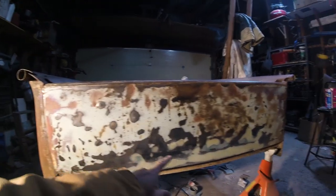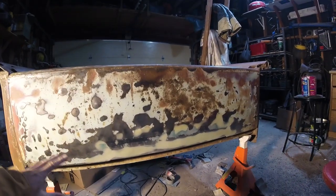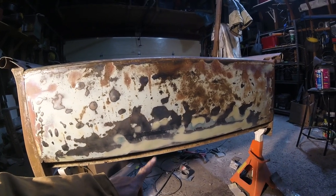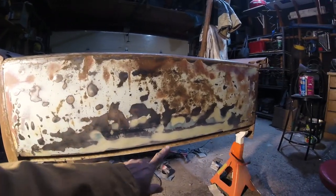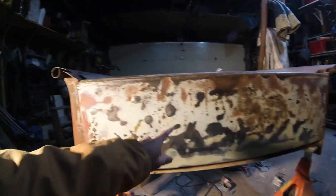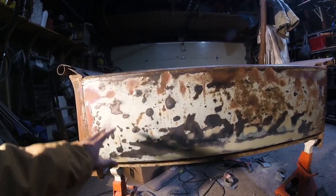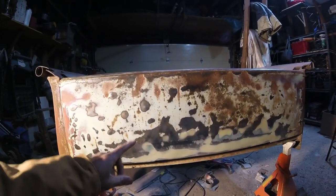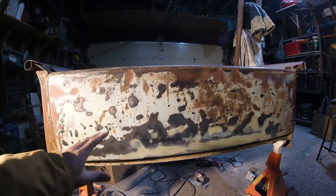The first thing we're working on is right here on this back panel that goes up against the cab. I'm going to prime all the spots where I added body filler so I can see where I'm at and if I need to add more. I spent a lot of time sanding this down off camera. This bottom area where the filler is will get some gray primer, and then some red oxide primer to touch up bare metal spots from natural dents on this back panel over time. I want some of that to remain when I patina this — it's the perfect area to experiment.